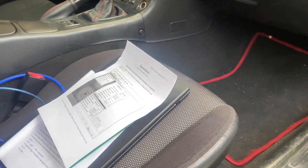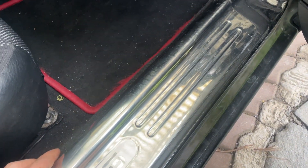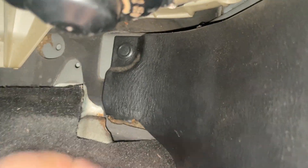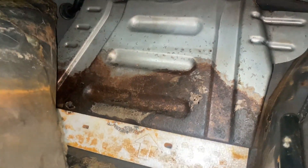Now let's remove the old ECU and install the new one. First you have to take out this panel right here and this plastic — this just pops up. Now there's a clip over there, and that just comes out very easily. We have to remove this one and it should pop out. I'll just pull back the lower mat, and there's the ECU under that cover.